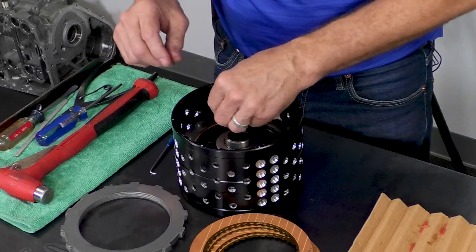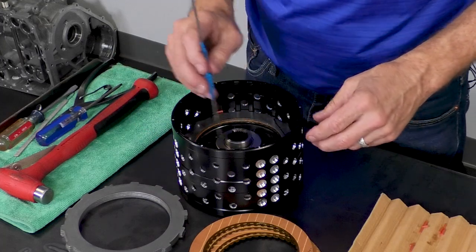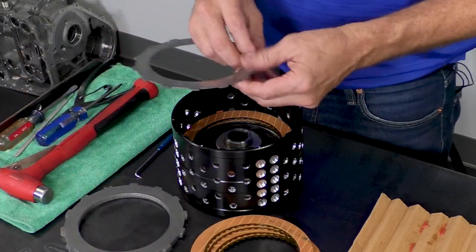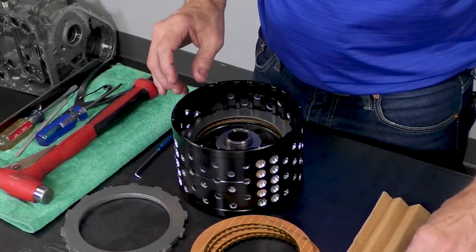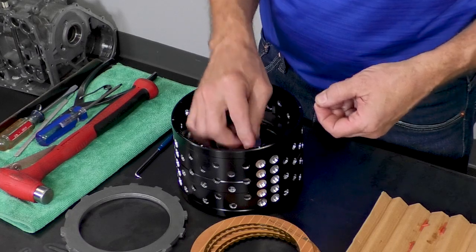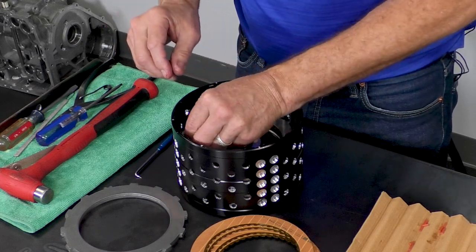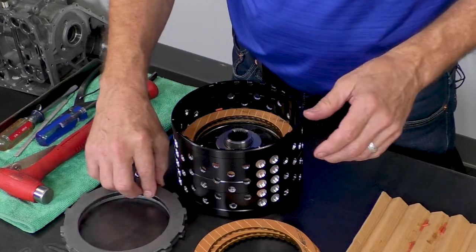And like we said, this is a trick that people have been doing for years, cutting up O-rings and making clutch separators. What we've tried to do here is make it all a lot easier. And it does help with open clutch drag and clutch release. While not necessary in every application, we do believe it's a detail worth considering when you're building these.